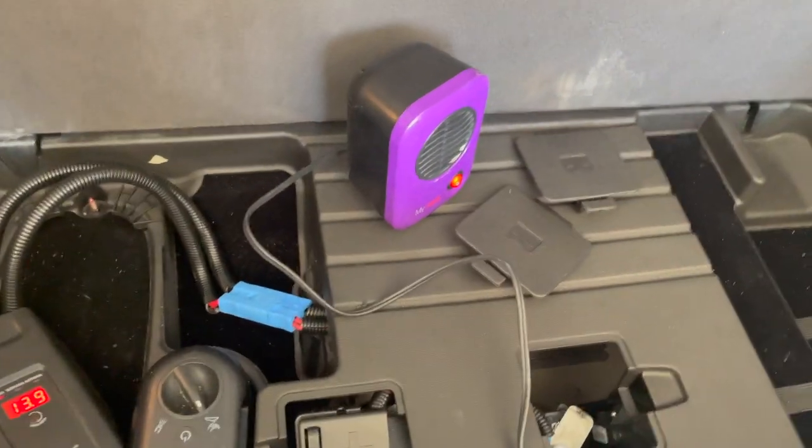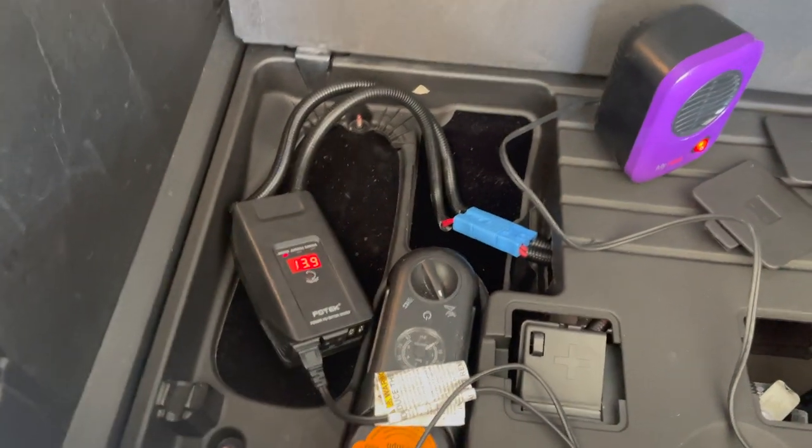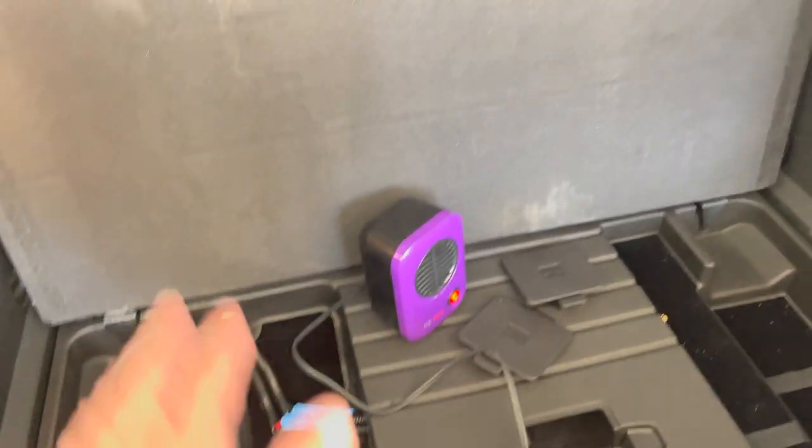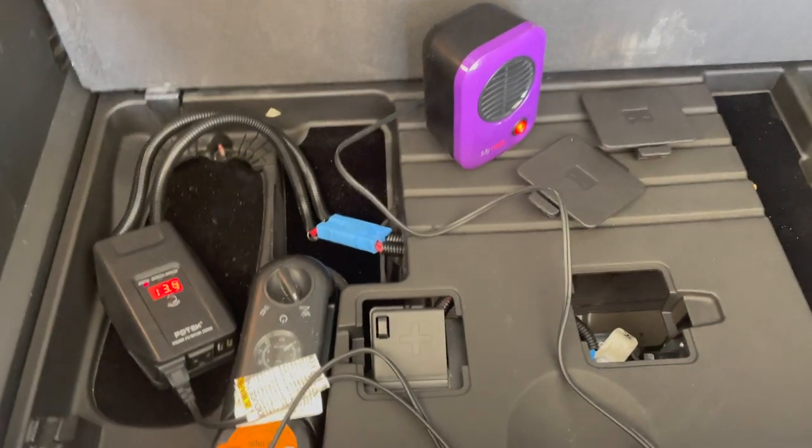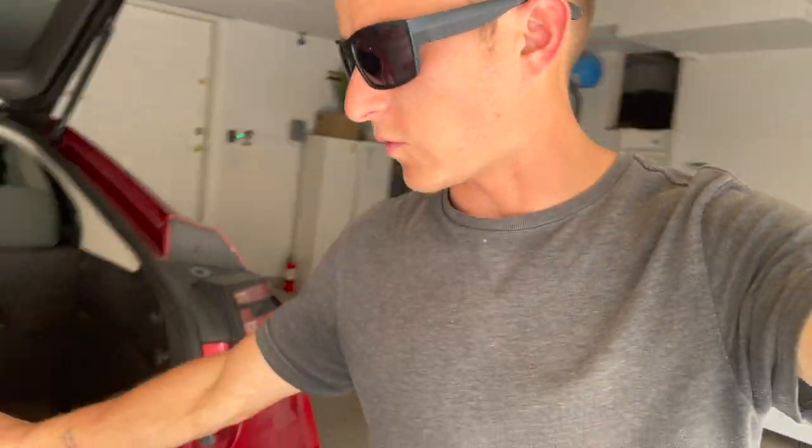That's the setup I've got going. It's nice to have in case you ever need standard outlets to plug anything into while you're out and about, at least as long as your car has high-voltage battery charge to recharge the 12-volt battery. And if not, the generator in the car will kick in to run the engine and recharge the high-voltage battery, which in turn recharges the 12-volt battery. So you can in fact hook up an inverter to your electric vehicle's 12-volt battery — the car's high-voltage battery, similar to an alternator in a gas vehicle, will keep the 12-volt battery topped off.